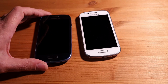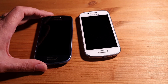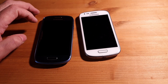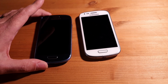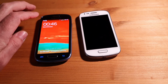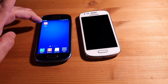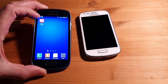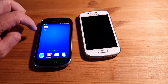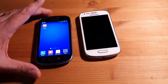So some specs about the phones. They have a Novathor U8420 chipset, a dual core Cortex A9 CPU at 1 gigahertz. They have a Mali 400 GPU and 1 gigabyte of RAM, which I think is the limiting factor on these. The 1 gig of RAM just isn't enough to run games and anything intense. Now, I have Dead Trigger on here, which is like a zombie shooting game, and it will run it. It plays fine, but it takes about 5 minutes to get actually into the main menu. Actually loading the game seems to take forever, but it runs okay once you're actually shooting zombies.